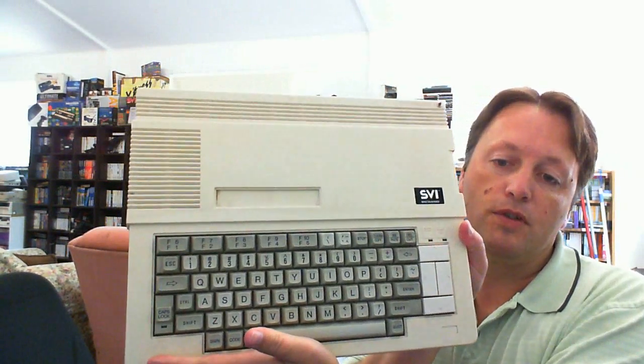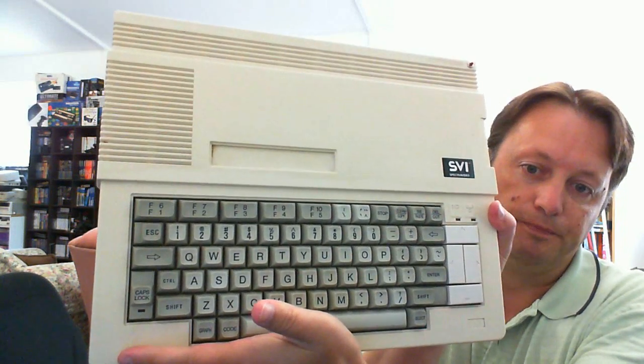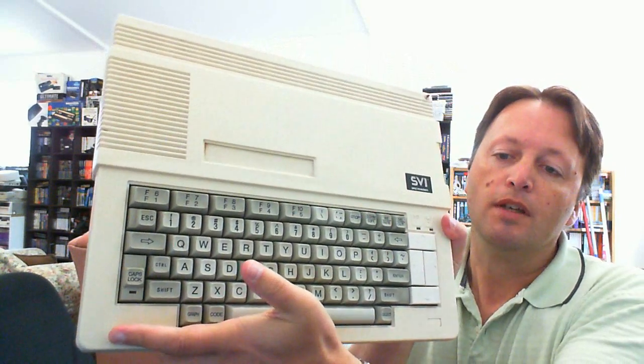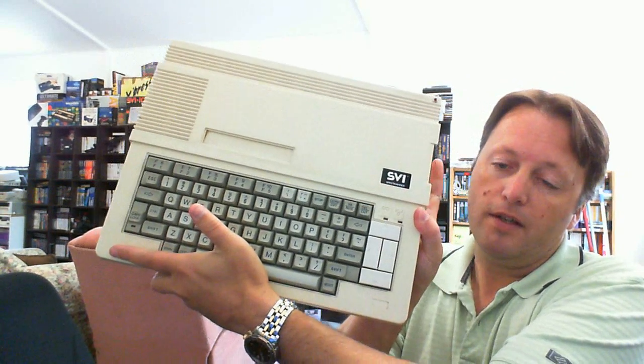So there was a common mod where you had to get a particular brand of double-sided drive, and put that in, and upgrade the ROM chips to support the double-sided, and I had to build frames to stand the drives on, because they didn't fit in the existing frames either. So that was quite an extensive mod. Machine was used heaps, and this is my original machine. It's not too bad, it actually probably needs another clean. It's all working, except for the fact that the drive died, so it's actually got its original single-sided drive back in there.